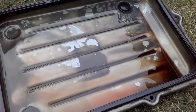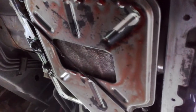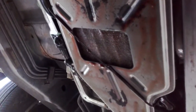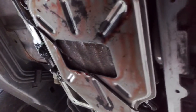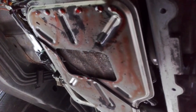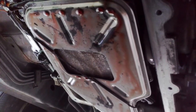There's a little bit of depositing there - the magnet's got a bit on it, but I wouldn't say it's completely full, it's still got room for more. That's not too bad. Maybe it had a service around 60,000 k's. The filter's not too good - you can see it's got a bit of crud on it. I'll see if there's a part number to check if it's an original filter. Looks like that's a Ford logo on the side. The nut wasn't butchered, so if it did get a service around 60,000 to 100,000 k's, they did a good job on that nut.